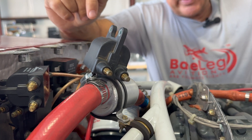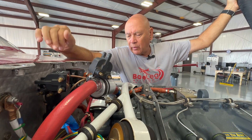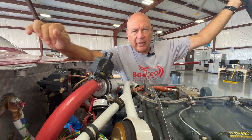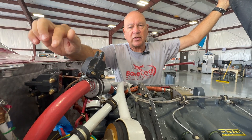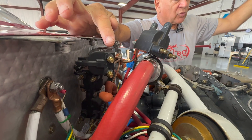In this case, just to save you a lot of time — we've actually gone through a lot of troubleshooting, swapped components, and verified that we do in fact have a bad box inside this aircraft. Talking with the owner, and considering the age and condition — it's fairly old — what we're going to do is put another ignition system on the other side. We'll probably use a P-Mag, because we've already got the wires and the P-Mag looks like it will fit. That way we'll have two separate ignition systems: one that requires battery power, and the P-Mag which above about 1,000 RPM generates its own power.